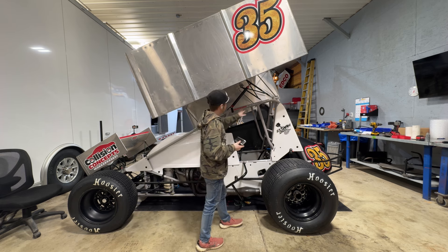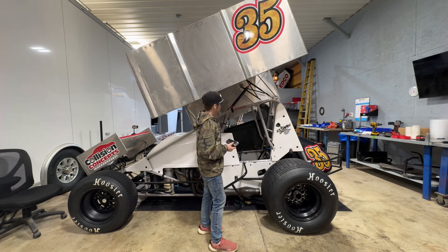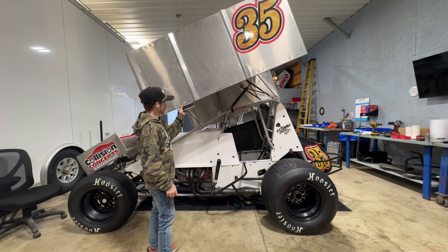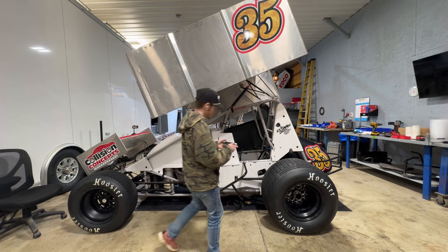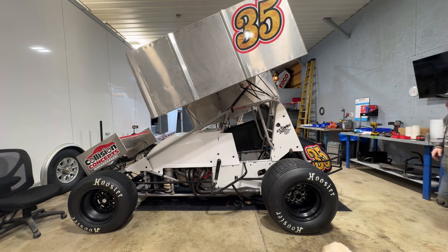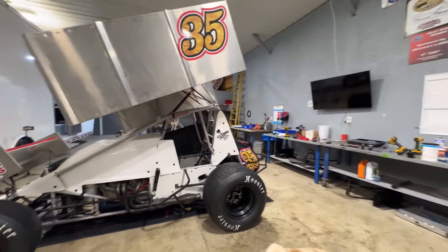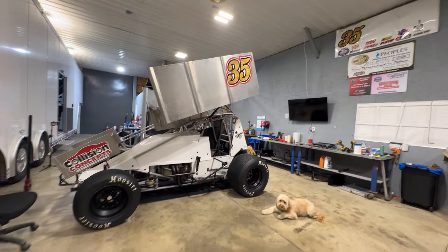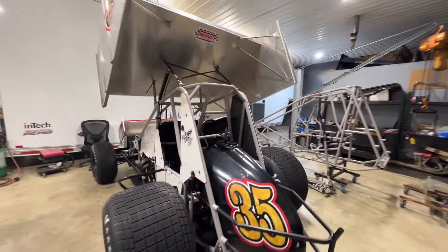I'm in my third hole here and I don't think I'm usually that low — this might end up moving back. I know I'm never going to go under 21.5, which is where we're at. Most nights I'll probably start around 23, even at a place like Knoxville. When I get all my wing trees right on all the cars, I'll find my happy medium. At a place like Knoxville I still have to play with it, so right now the wing is flat — it'll be a little more back when I move my wing slider.